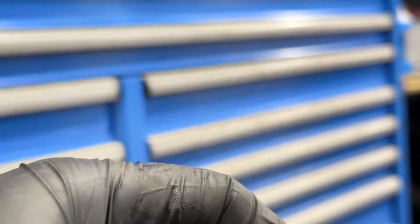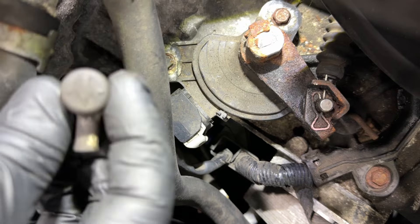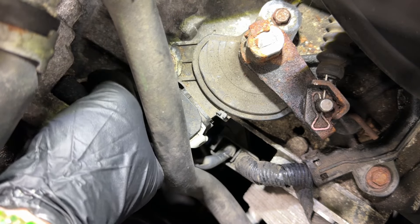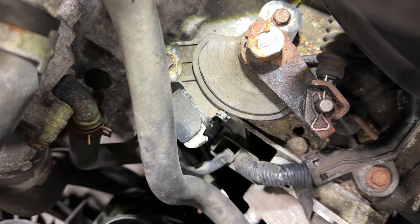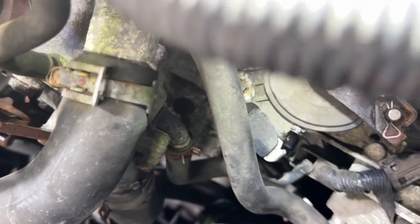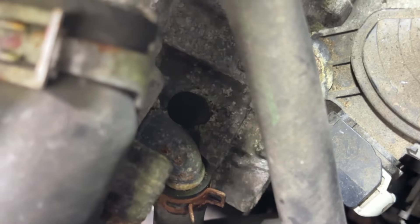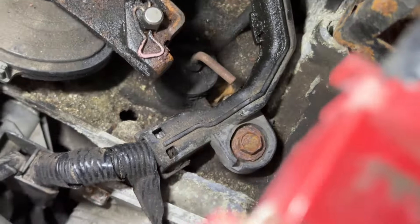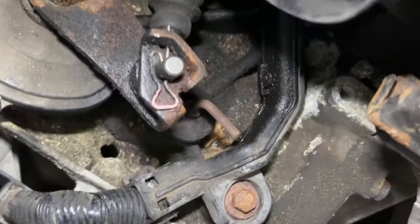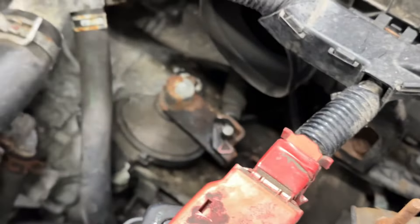Make sure there's nothing in here — no big debris — and you should be good. Now it's time to put this back in. Remember the direction — I don't really think the direction matters to be honest, but we're just going to follow instructions. Put the cap all the way back in. Face it towards this hose right here and don't put it completely the opposite way. The plug is back in. Now go ahead and clean any debris or oil residue with some brake clean or something like that.